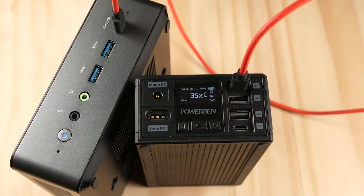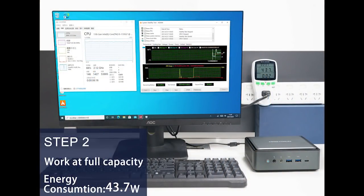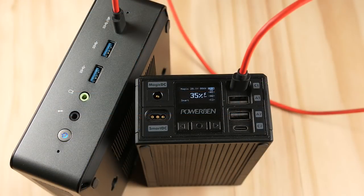The last interesting thing I want to mention is that you can power this PC from a portable charger if you have one that's powerful enough. They rate this at 8.6W at idle and 43.7W under load, and that's largely going to be the case unless you have a bunch of peripherals plugged in. The TDP won't go that high on this board, so you shouldn't have to worry about heat or going over the included wattage of your power supply.